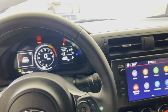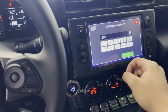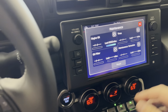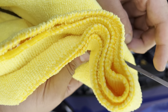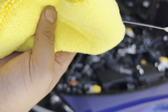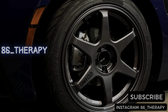As the car is warming up, we can jump to our maintenance settings in the car — tapping on maintenance and then going over to engine oil to set a distance reminder. I like to do every 3,000 miles or so. Now we can go back to our engine bay and check the engine oil levels. We're right at that second dot for oil — right where we need to be. I'm going to drive the car a few times around the block just to make sure we're getting a correct reading, and add oil if needed. And yeah, that's basically it. Thank you.